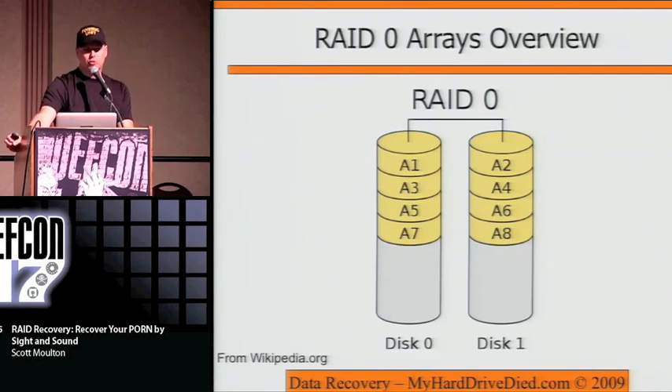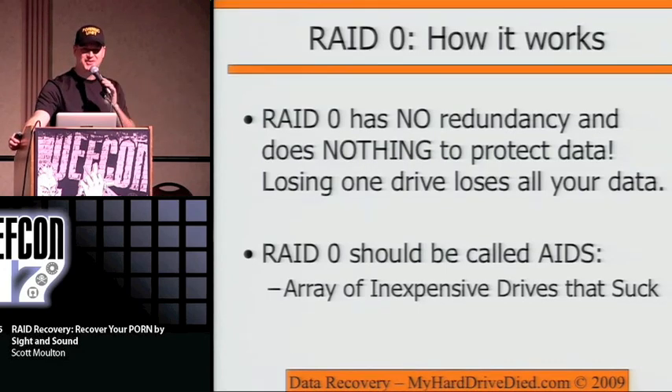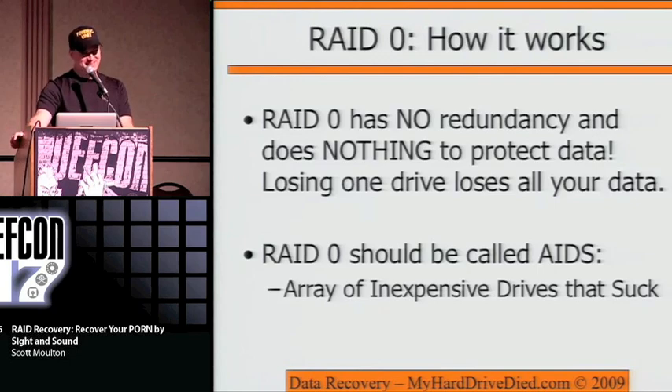It's almost never the standard size. Most motherboards that are locked down will have a standard slice size that rotates between the drives with your data. If one drive is dead and you cannot repair it physically, you will not get anything worthwhile out of it — basically just thumbnails, nothing really valuable, depending on slice size. With 32K slices, 32K is gone from every other chunk of every file, so you end up with nothing. RAID 0 has no redundancy at all. I try not to call it RAID 0 — I call it AIDS, because it's a RAID that's going to suck.